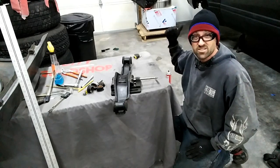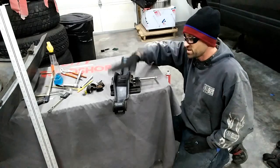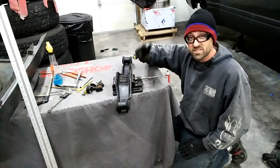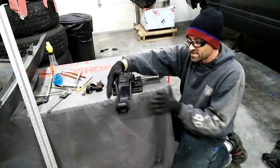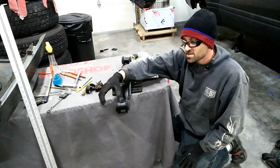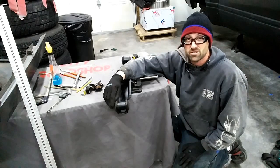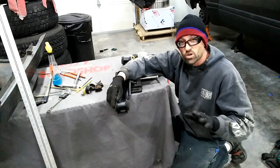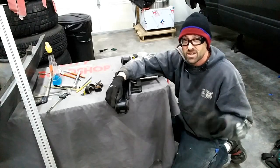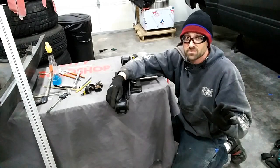If you look behind, there's no transmission because I've already put it in the car and I'm waiting on the crossmember to go in. The crossmember is the one I kept from the 92 because it matches the V8 double hump. The car is an 80, so those won't bolt together — the difference is in the ends. The 92 and later models are actually wider where they mount into the car, whereas the earlier models like 79 and 80 are thinner. I ended up measuring the car and it's about 66 to 70 millimeters. I've worked so long in Japanese auto factories that I don't think in inches — I literally think in millimeters.